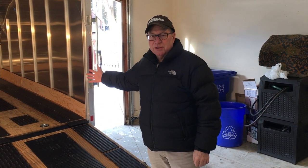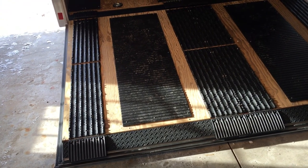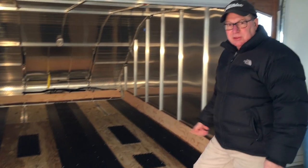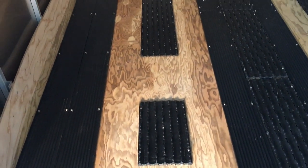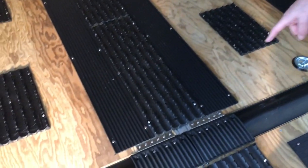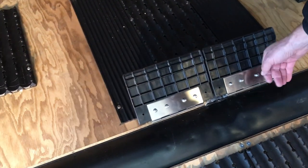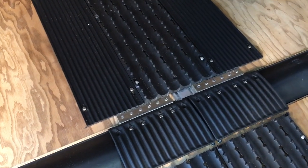So we have the finished product, all of the pieces installed. You'll notice the glides are installed on the door to handle the angle. On the interior, because we're not running sleds with studs, we didn't see any reason to run all the way up the center — besides, it's just a place for moisture to gather. So we used some leftover Grip Glides in the center, which will fall basically underneath where the paddles lie. Looking down at how we've brought these up to the edge of the hinges, it allows the door to fold all the way back with no risk of pinching. We originally ran one up too far and realized it was pinching when the door closed, so that's the right way to install those.